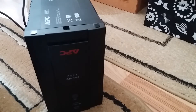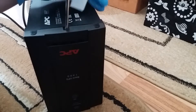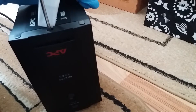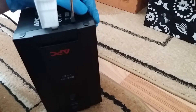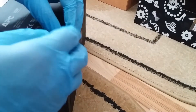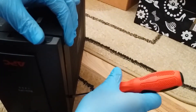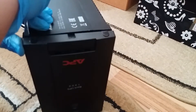Use a slotted screwdriver and a plastic doorstop to detach the front panel. Push the doorstop in there until it remains fixed. And continue using the standard screwdriver to push inside the front panel edges. Also try to twist it so you can detach the front part of your UPS without breaking it.